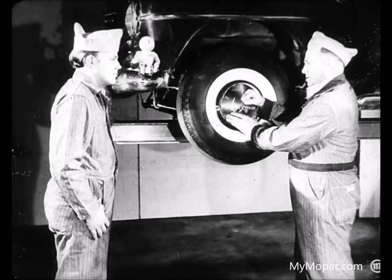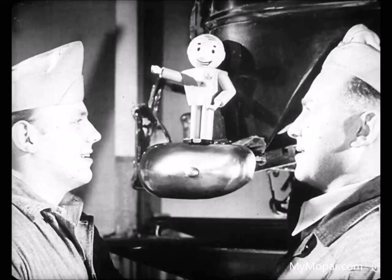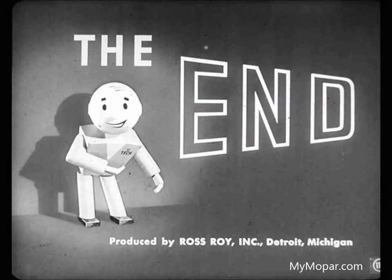Then we can road test the car thoroughly and make sure we did a good job. Frankly, fellas, I know you did a good job. And if you'll always check adjustment, tightness, and brake shoe alignment carefully, you'll never have much trouble getting rid of brake noise.